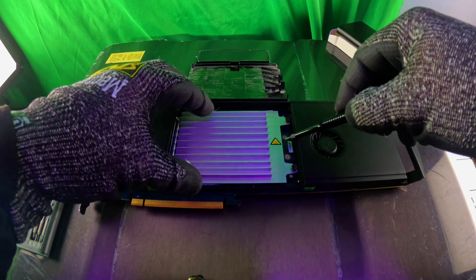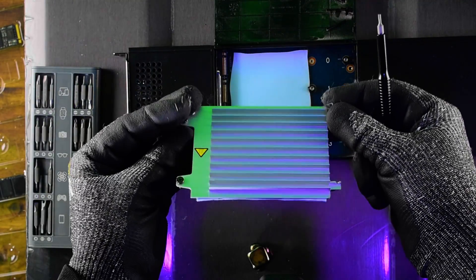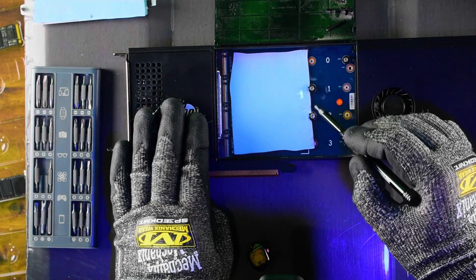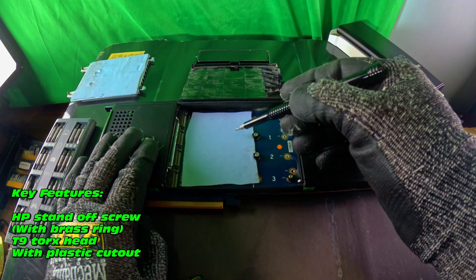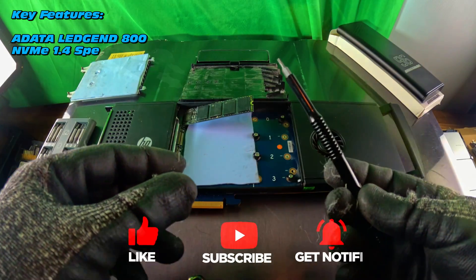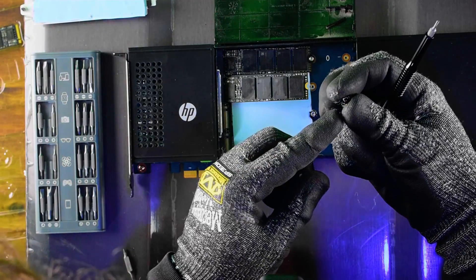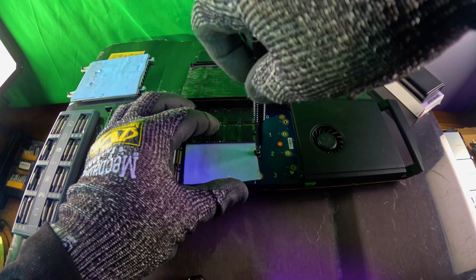HP has managed to secure those screws — they will never lose their mounting. This bracket is really cool: there's thermally conductive silicone and a very nice heat spreader. Take note of those two little clips — very important. Clip that in for fitment and make sure you get a nice flush fit — it can be a little tricky. The standoffs are really cool as well because they allow the NVMe to fit nice and snug. Taking our ADATA two-terabyte Legend, there's a nice recess that allows it to fit within the NVMe slot — so compared to other systems, these don't go missing. Just put them in the slot, press them down, and away you go.